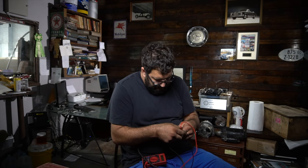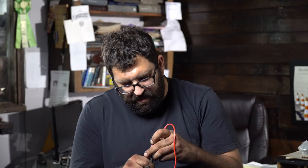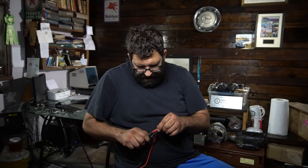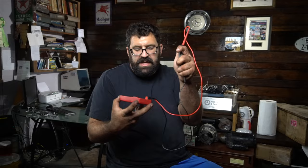What is going on? The ohmmeter is good. So we can check the individual parts of the wire. Shoving our connectors in there, I'm getting nothing. You can actually buy the wire from Mercedes. Now let's test the resistor end — I'm getting a reading of 1325 ohms, which is pretty good, just a little higher than I'd like. So we know that this part is good. You can also buy just these resistor items new from Mercedes for a little over $40 each.